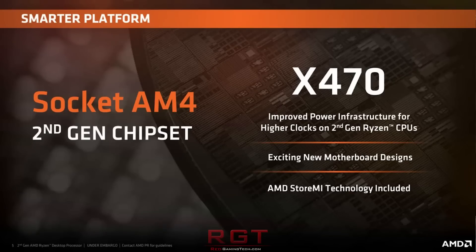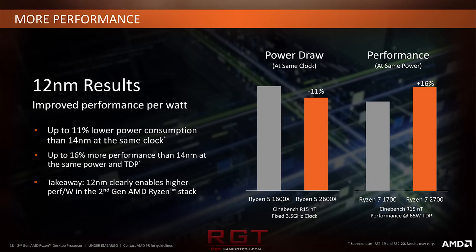With all that said, there are clear advantages with the 400 series board. Many 300 series boards did suffer from issues with getting RAM running at over 3000MHz, and this is clearly not the case with the 400 series. This particular MSI Gaming Plus managed to run at 3466MHz out of the gate, which is a clear major upgrade from the 300 series. If you're thinking of changing your RAM as well, the 400 series motherboards are much happier to comply with higher clock frequencies. Plus, there are other advantages such as higher bandwidth for PCIe devices, better power distribution, and many other things besides — so if you are buying a new rig, without question, the 400 series motherboard is the way to go.